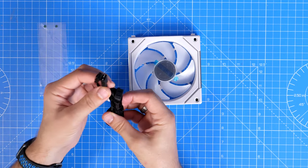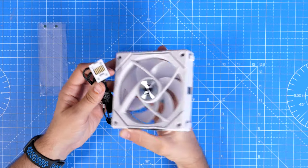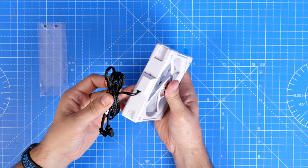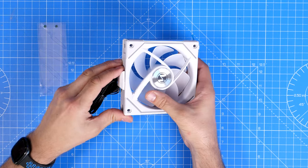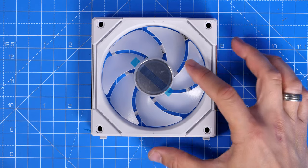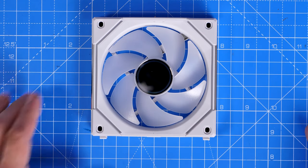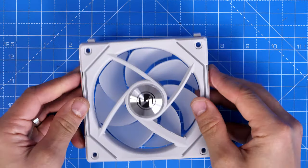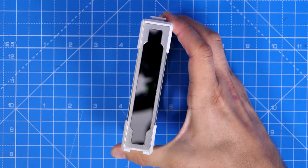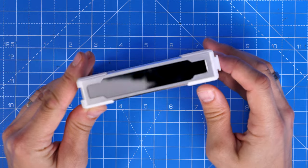The final fan can have the pins removed. The new interlocking adapter connector is ever so slightly smaller and fits in the middle of the fan now — it has both RGB and fan power connection on it. That means if you buy an individual fan, you can connect up to a system fan header and an RGB header on your motherboard without a control box, making it possible to control these fans without a controller — potentially up to six fans.